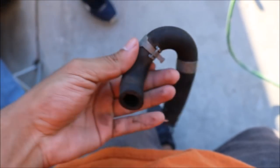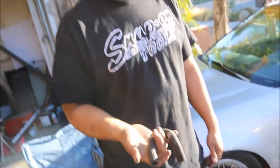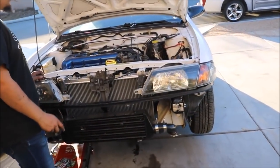Both sides. So I'm gonna go grab a new hose. This explains why this did not idle. I know, this did not want to stay on. I was scratching my head because my new ECU has a base map, but I'm supposed to use an N62 map. So I threw my stock ECU in, stock map, and it just stopped idling. Voila. Yep, this is an issue on the idle control valve. Simple little hose. So we're gonna go grab a new one real quick, and hopefully that fixes everything.